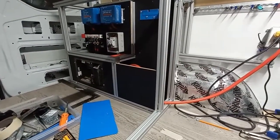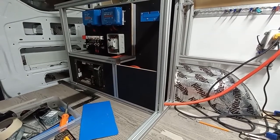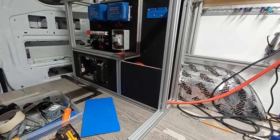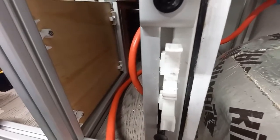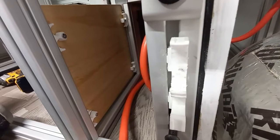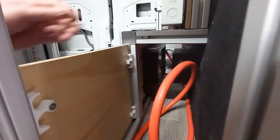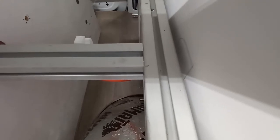This is where the electrical panel installation is going to go. We're on the driver's side at the back of the van. I've got two panels attached with my little clip system. The clips in preparation for the plumbing are here, and here is the same clip using the little hole and the three-quarter inch back-set to hold the metal on. That clip is also going to be holding my number 10 wire as it comes into the van — it'll clip to that piece of 8020 and go in. It's the same size for that as well.